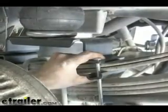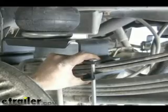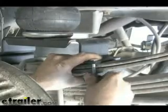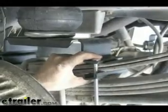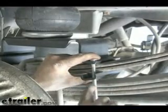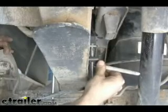Let's work on our bottom bracket going through the springs. The clamp on the bottom side will sit just like this and we'll drop our bolts through and clamp to the top overload spring right here. Now you could go to the bottom, however over time the springs will compress enough where it could shift around and possibly damage something on the airbag itself or come out of alignment. So we're actually going to clamp it to the helper spring itself — it's okay to do that as the instructions state. However the bolt is really long if we're going to do it that way, so we're going to make a mark on the bolt and cut them short. The bolts going toward the front of the vehicle are going to be a little bit longer than the ones in the back.